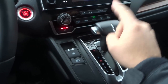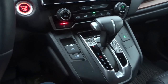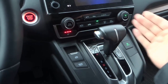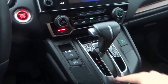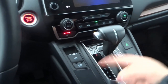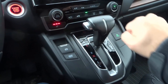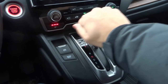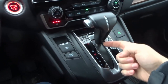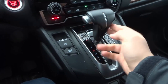And what I actually did right there — tapping on it really hard — is not a good thing to do either, just as a sidebar. Moving forward to number four: you don't want to apply sideways pressure to it. This shifter is only meant to go down and up — that's it. It's not meant to go side to side. Some shifters are, like in our other Mazda 3, where you push the shifter to the side to bring it into drive. But not this one. You don't want to apply sideways pressure to a shifter when it's not supposed to be applied. Don't apply any sort of sideways pressure to it.